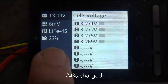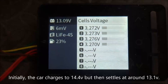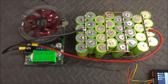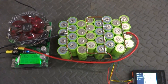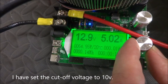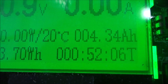The pack is now complete, including balance leads that I installed and have connected to the meter. You can see it's indicating only about 20% capacity. The reason for that is that the Nissan Leaf, once it fully charges the battery, allows the voltage to get to a little over 13 volts, which is not ideal — meaning I'm not going to be using the full capacity of this pack. I have it connected to a load tester and we'll find out the pack capacity based on the voltage it'll see in the Nissan Leaf, using about 5 amps. The test has finished and we obtained only 4.34 amp hours, which is a lot less than I was hoping for.